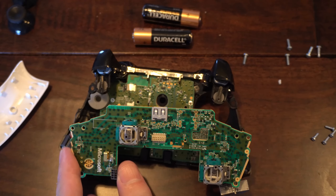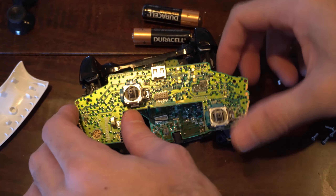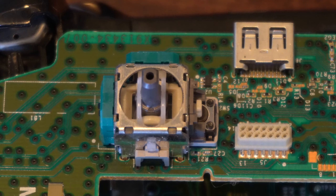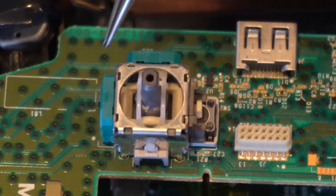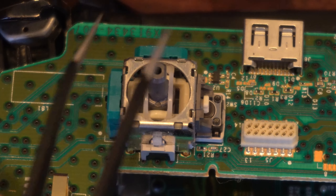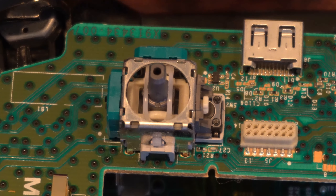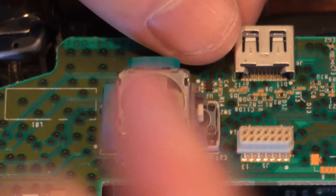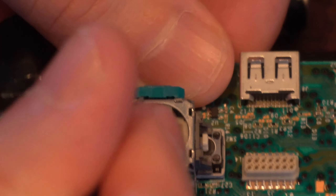Now find the thumbstick that you've been having a problem with — it could be the left one or the right one. In this video I'm going to go with the top left. What we're going to want to do is open up these green pieces right here — we have two of them, one on each side. Then what we can do is clean everything off. You're going to want to get something with a good edge on it, and I would avoid using metal. If you do have a plastic piece that can open up this side, that will work so much better. There's a little bit of a gap right here where we can place this object and slowly pry it back, and then work it on the other side too.